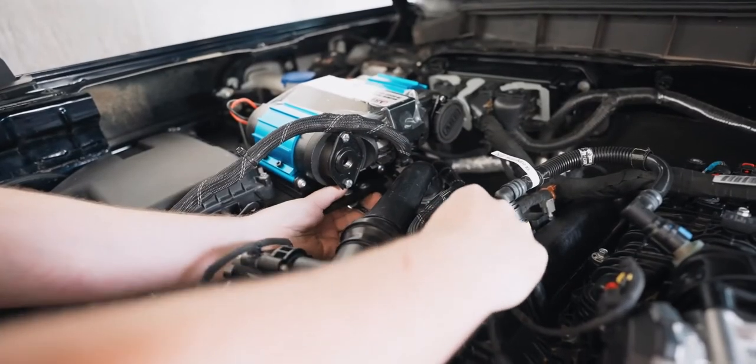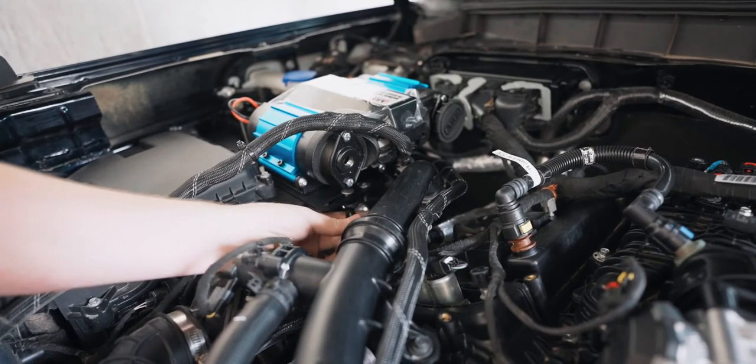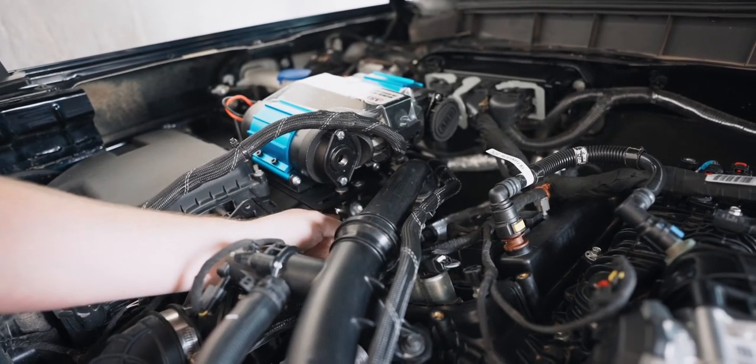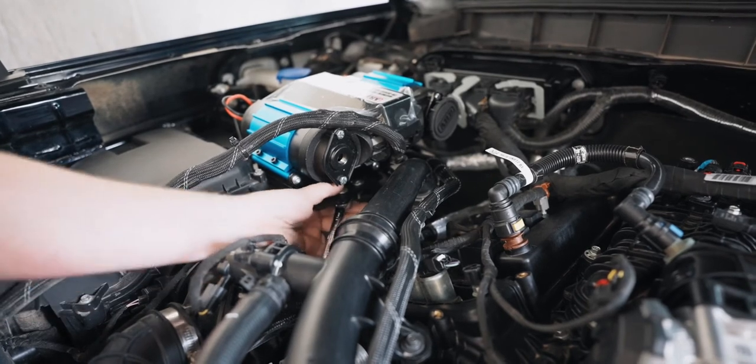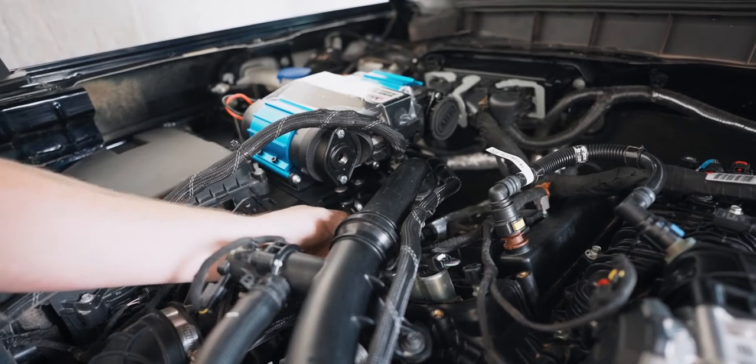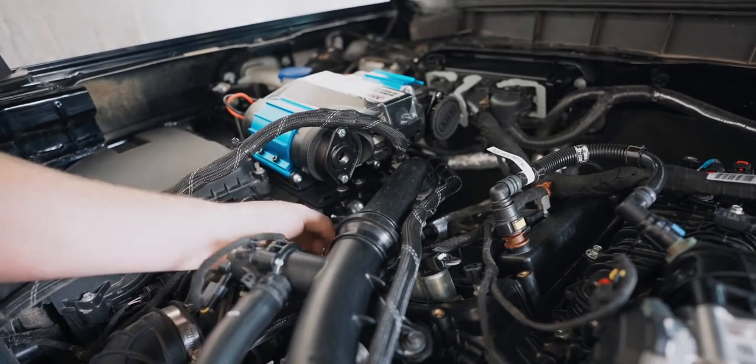This next part was tough to film. Use the provided carriage bolts and nylox to secure the foot of the plate. You'll likely need to bend that foot slightly towards the engine to get everything to line up. This is by design, and it keeps everything super snug. It doesn't move at all.